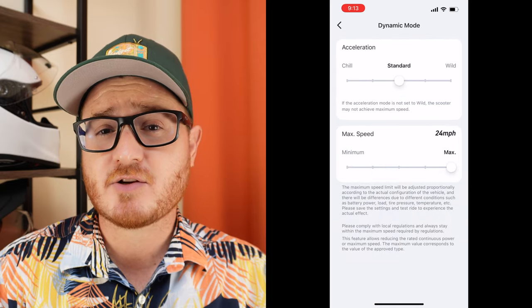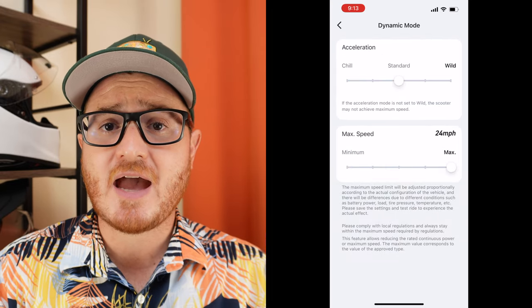The nice thing about this scooter is it is app enabled, so if the acceleration settings out of the box are a little too strong for you, you can go into the app and make adjustments to the acceleration strength as well as a host of other settings. During my testing, I did get some comments and see some forum posts about the jerkiness of the acceleration. What I found is that with the default acceleration settings and default regenerative brake settings, as soon as you release the throttle, the regen brake kicks in — so if you apply throttle and release, you'll accelerate and slow down really quickly, which can give it a jerky feeling.